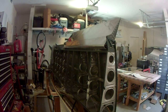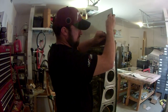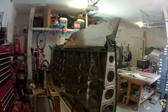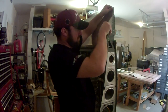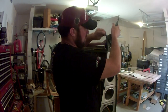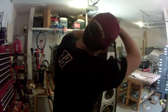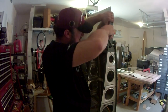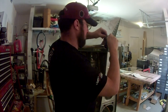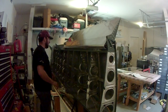Here you see me starting to work on the bell crank assembly — assembling the aileron and putting it in place onto the wing. It went on fairly well. They have a washer wrench that I purchased but I wasn't able to find it, so it made for a little bit of a difficult effort trying to put these washers in place. I put the aileron in place and then started working on the aileron bell crank assembly, torque tubes, and all of the mechanisms that operate the ailerons from the control stick.